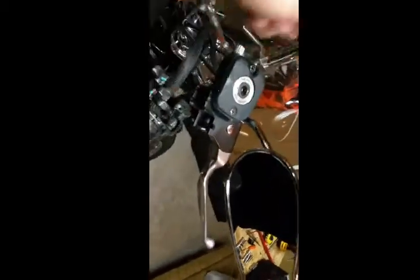Next, this little piece here goes up in a hole — pop that out. I grabbed a needle nose and pulled it out and it didn't damage too bad. You may have to run to Harley or somewhere and get a new one. Then just pull this assembly off. I ended up snipping the previous zip tie in order to pull it off.